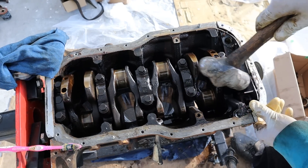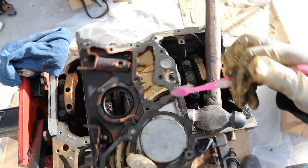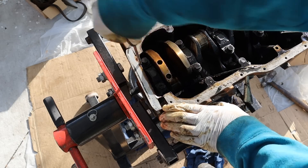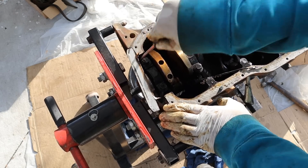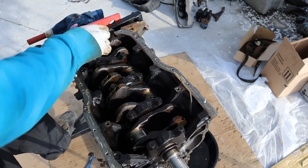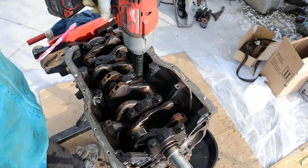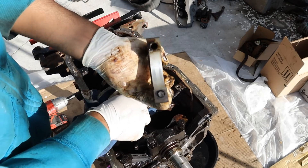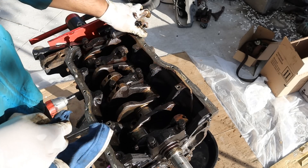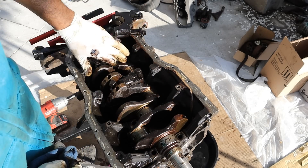Next up we're going to get the oil pump housing out. The oil pump is pretty straightforward — oil goes in here and comes out through here to be exhausted into the block. I'll remove the rear main seal, then remove the bolts before putting it on the engine stand. Now all I've got left is the rotating assembly. I'll remove the 10 bolts holding the main cap bearings on and take a look at the condition of these bearings. It's actually pretty clean with only very slight scoring. We don't know the mileage, just the age, but it's not in bad shape — this engine hasn't failed from oil lubrication issues or anything like that.